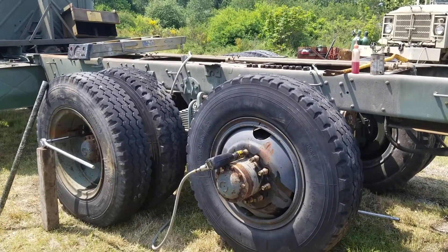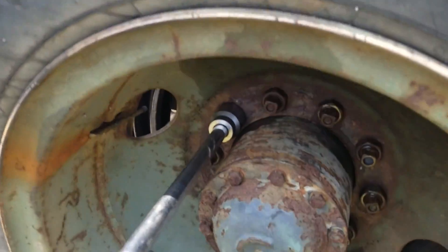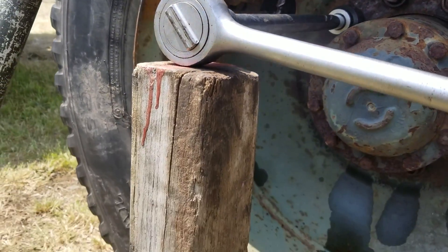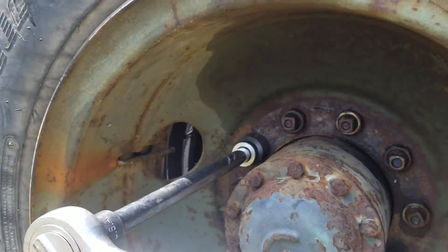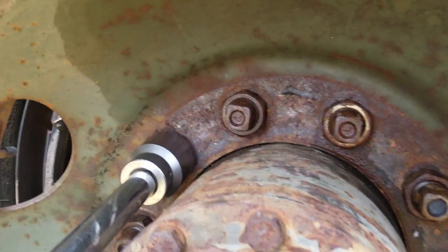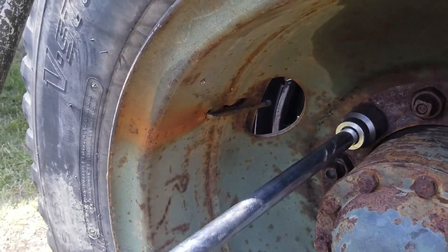This is my first real experience taking dualies off. You've got to loosen those lug nuts — 10 per wheel to take this wheel off. If you don't brace this with something it's so floppy, you're either going to slip off and break the socket, or the socket's going to break and you're going to hurt yourself. This just doesn't work.